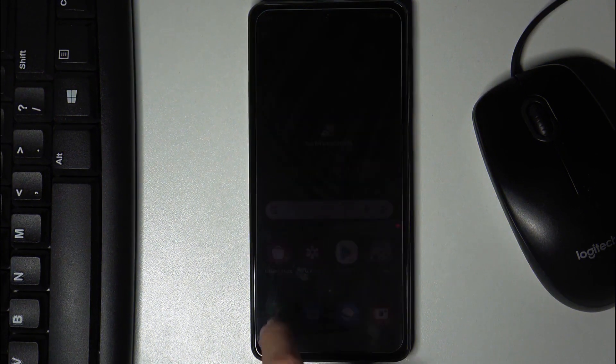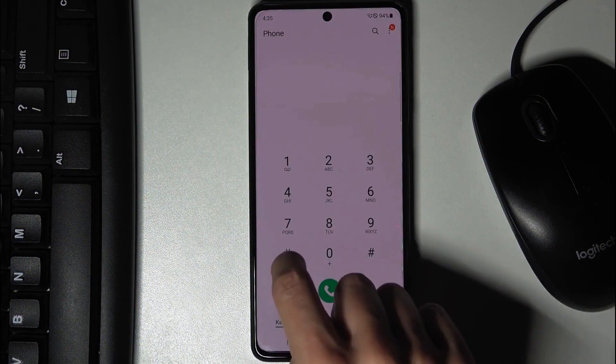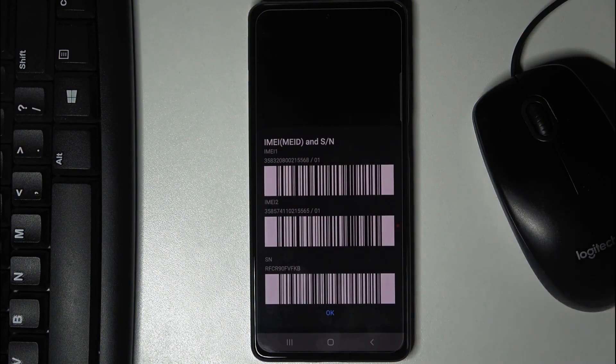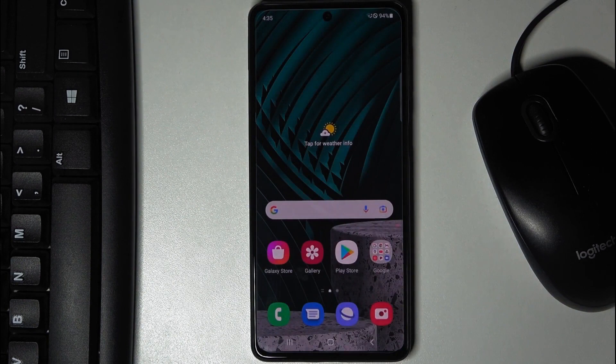To start, we're going to get the phone's IMEI number — that's a unique number for every phone. To get it, simply dial star hash zero six hash. As you will see, your 15-digit IMEI number will appear on the screen. This number is very important; it represents the ID of your phone. Keep it somewhere close because we're going to use it in a few seconds. Now we're going to switch to the computer.